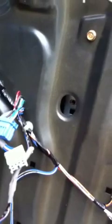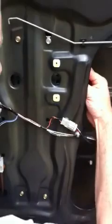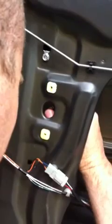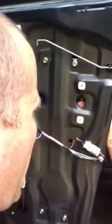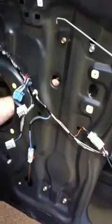Oh shit. Oh yeah. Told you to throw them down inside the door, right? Now, here they are. Right inside the door. One started, just go ahead and get it all the way down with your fingers. That way, when you take your hands off it, the glass doesn't come down on you. And you're free to use both hands on the next side if you need to. Okay, so right in there. Might have to manipulate it a little bit on the window, but nope, actually, I don't. Got lucky this time.